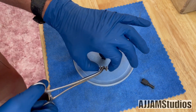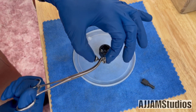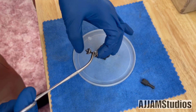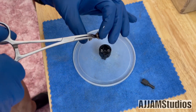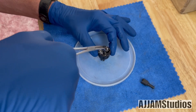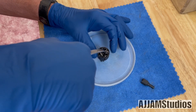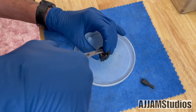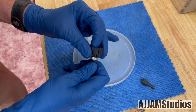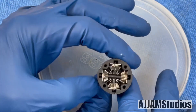Second one — make sure that notch is down this time because they have to interlock. Those shims have to be textured side up and down; the smooth sides are on the sides when you slide them in. Slip it down in there — see how they're smaller? They go right in and then you just push them to the side and they fit right in. Don't forget to sink it — twist it a little bit until they lock into place. You'll be able to tell because everything will move nice and smoothly.